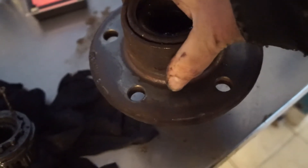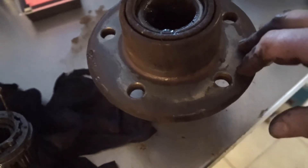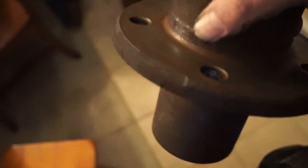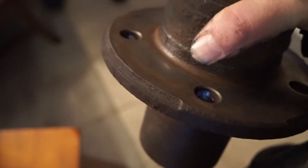Here we are in the house. What we did is we removed the rotor by pounding out the studs with a regular handheld sledgehammer — just laid it upside down so the points of the studs were upward, and we whacked them with a hammer. After about two or three hits each they just popped right out. The rotor we're going to replace, so we banged it down a little with a hammer. There's actually a flat spot right here that allows you to get a wedge or screwdriver in between the rotor and the spindle hub to actually separate it.